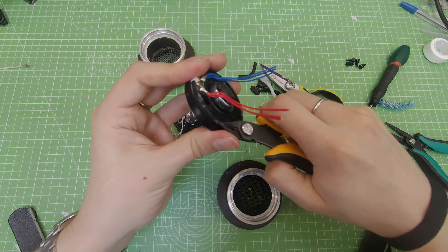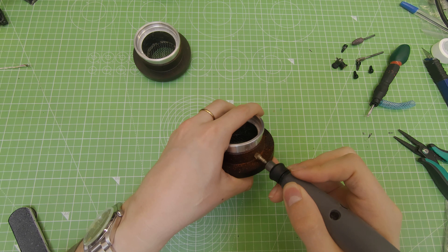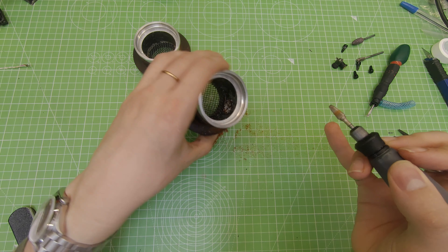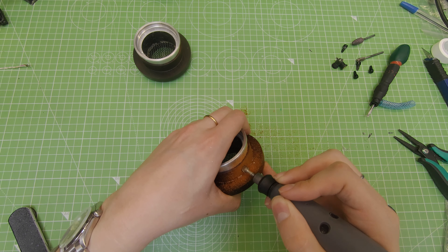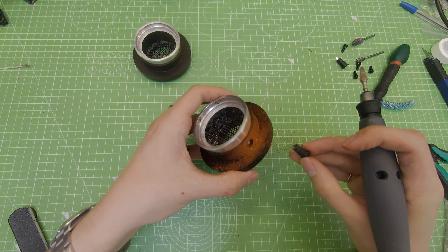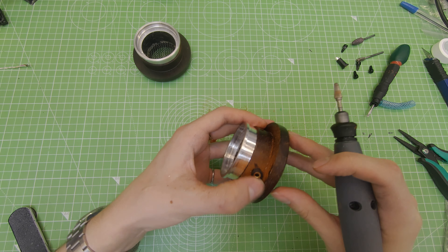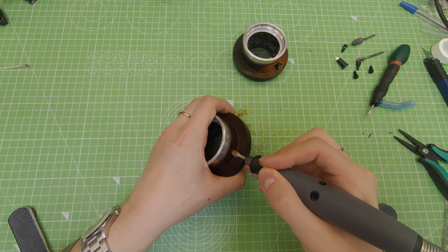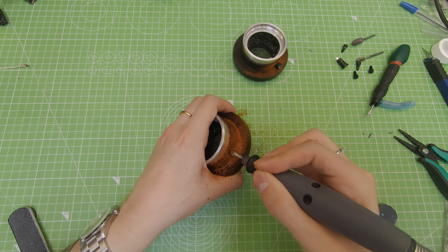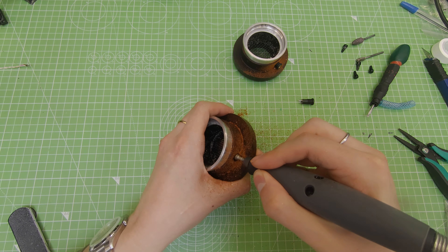There's the glue — I'm just snipping it off the side, and it's finally time. This is the scary bit: you get to drill a big hole in the side of your Grados. I've sped it up here. This process does take a little while, and you get yourself covered in wood and metal shavings, which is lovely. Just making sure that the little 3.5mm socket fits in there, because that's what we try to use.